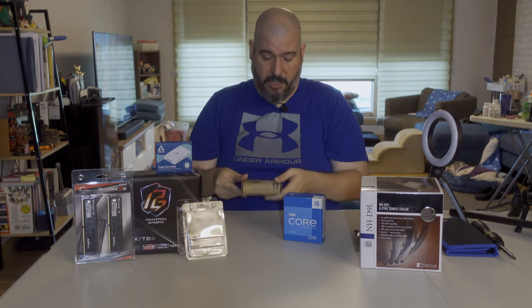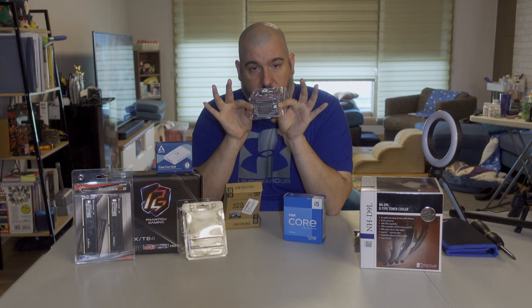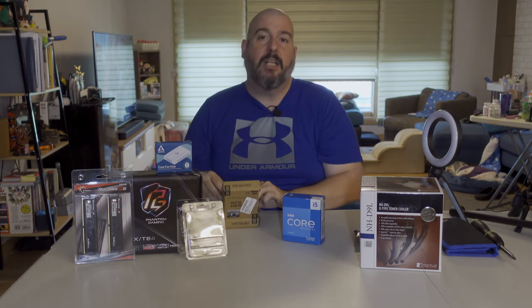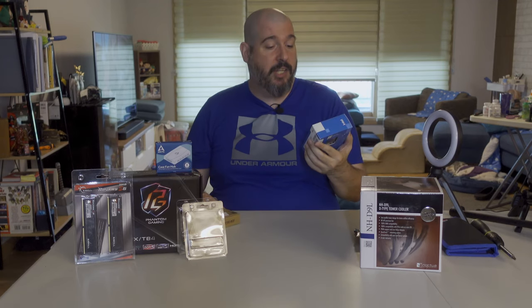To go along with that I bought one of these — it's from Thermaltake and it's basically just a CPU holding bracket, because apparently the 12th and 13th gen CPUs have some issues with the CPU bending after a while in the regular lever bracket. It's more common with the i7s and i9s due to higher core counts and higher heat, but since this is right on the edge of i5/i7, and it has onboard Intel graphics, I figured I'd be safe.